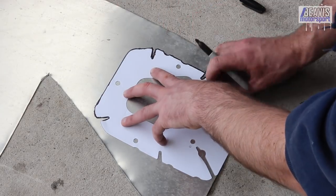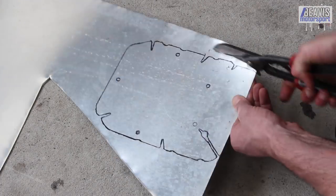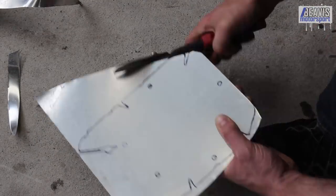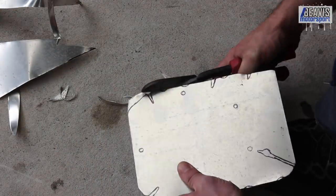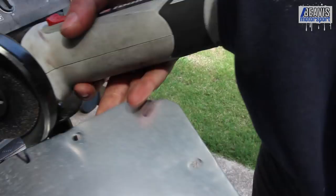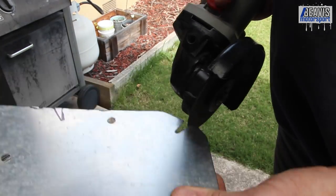The Mazda BP engine with the relatively deep lower section of the sump at the back of the block and the inbuilt baffle design all help to avoid chances of oil starvation under heavy G's, but the sump can still be improved. There are a few off-the-shelf baffle designs, but a simple option is a precisely shaped sheet like you see here to fill some of the perimeter gaps around the OEM baffle plate, so that should be a good alternative.